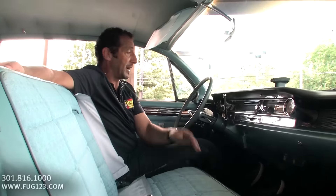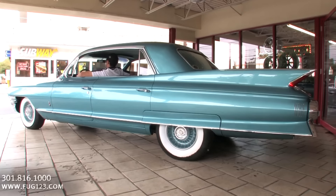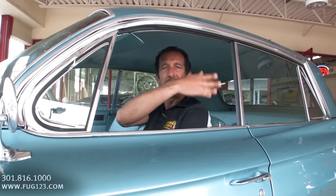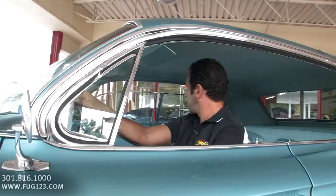With the big 390 cubic inch V8, these cars were not only comfortable to drive — they were very powerful. With all the accoutrements on this car you want good power. The transmissions were a little ahead of their time too: most cars had two-speed automatics back then, but this car has a three-speed automatic. Part of the style of this car is it just keeps going and going. When you drop the window — most cars have an A pillar, a B pillar, and a C pillar, and to get rid of the B pillar you have to really strengthen the body of the car, and that's what they did here. Look how cool that looks. This is style. This is a 50-year-old car, just loaded with features and options.